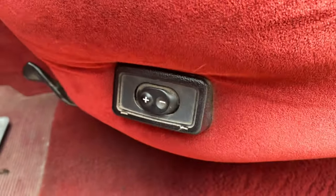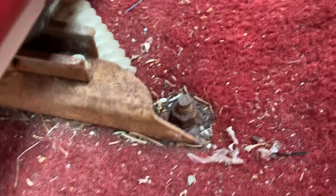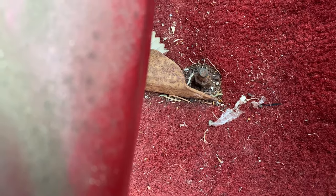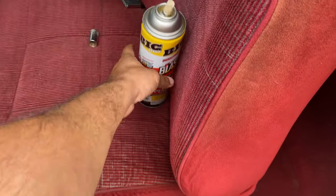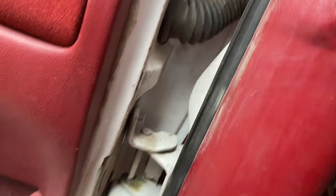We're going to see what we can do. First we need to get this seat out. I'm not really sure what that's for — it might be lumbar support. If I flip the switch here, yeah, it looks like we have a hose coming up through the back, so that must be lumbar support. Now we can get to these nuts right here — they look rusted like everything else on this truck. We can see a lot of rust here around the base, so it might be so rusted out that we just snap through the floorboard. It's not budging, so I soaked it in PB Blaster. We'll let that sit and start working on pulling out the door cards. Looks like we have a Phillips head screw here and some along the edge, one up here, and some along the bottom.